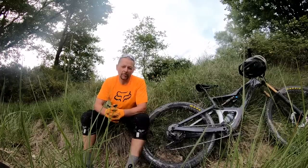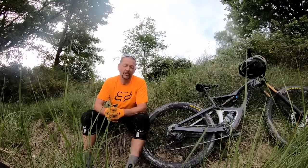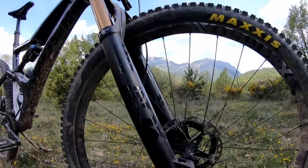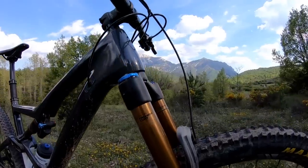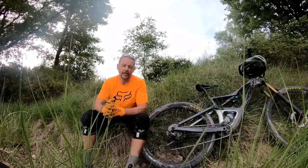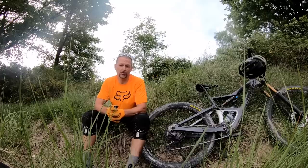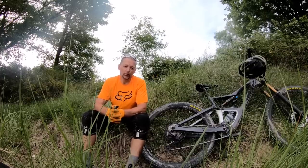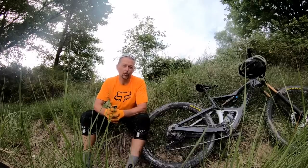Because we were going to be riding some pretty epic terrain — including an EWS stage and some pretty gnarly downhills — Orbea chose to set us up with a Fox 36 up front at 150 millimeters of travel, which bumps the head angle to 65.5 degrees and the seat tube angle slackens out to 76.5. This upgrade is available through the MyO program — at the same time you pick your colors, you can specify all kinds of things on your build, which is a pretty nice way to tune your Occam to the particular type of riding you intend to do.